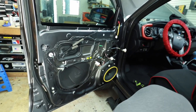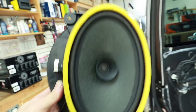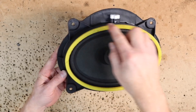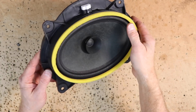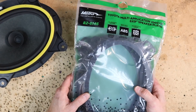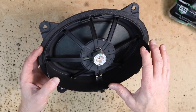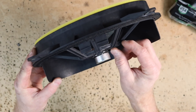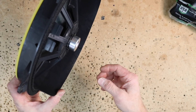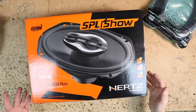Fernando has the door panel off. At the bench, a lot of people confuse this factory speaker as a standard six-by-nine, and the inside area is six-by-nine, but if you just go buy a six-by-nine it won't bolt in because of the big plastic bracket. We'll use the Metra 82-8146 adapter to make it work. The factory speaker has a small neo magnet glued on the back — we've actually seen these break off and get stuck inside the door when you close it, causing a 'tink' sound and then no audio. It has a cloth surround and a paper-treated cone. The replacement is the Hertz SPL Show SX690 Neos.